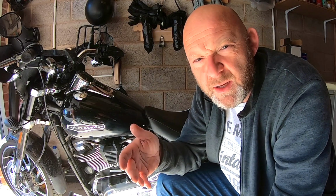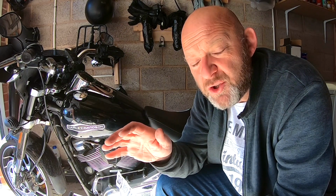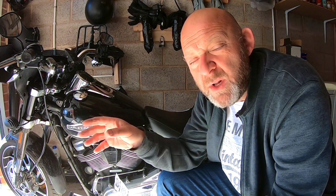All the checks that you could do, a process of elimination. Anyway, the next day when I went to start the bike again, a cold bike as it were, it's exactly the same problem again. Now what I'm getting here is just a faltering start. I go to press the starter, there's a momentary lapse where nothing happens, nothing engages, then the starter engages, and then it cuts power to the instrument module, and then because the power's cut to the instrument module, the clock loses its time reference, so then I have to reset the clock.